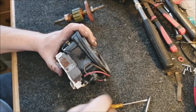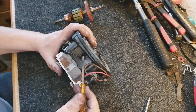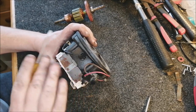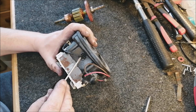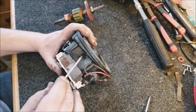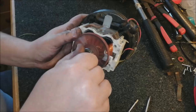So they will basically only take one flex. When they're originally made, they're bent in, then we bend it out, then we bend it in again, and that's it. They will take no more than that. So whatever you do, don't mess it up when you put the brushes back in, because if you try and do it again, they will snap off. There's only a limited number of flexes on these. So next we pop the armature back in, like so.